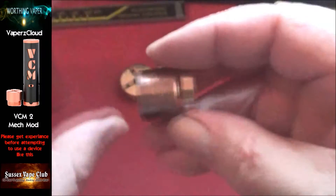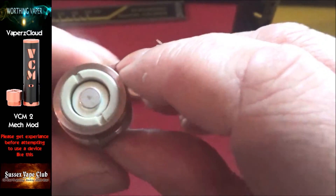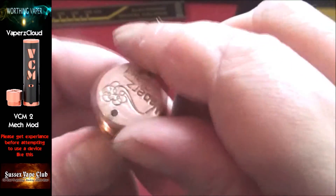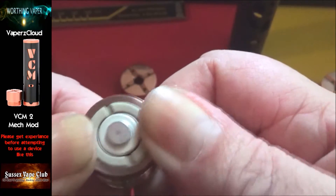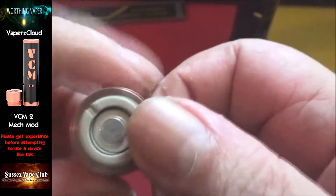There are no rough spots on them — they are smooth like butter. The switch is quite good; the throw on it is not too bad, although you can alter the throw if you so wish. My mate has it set up the way he wants it. Inside the switch you've got two magnets. The actual contact point is made of beryllium — it's a silver-plated beryllium, which is a good contact. It sticks out quite a way. You've also got an insulator there which can come out.